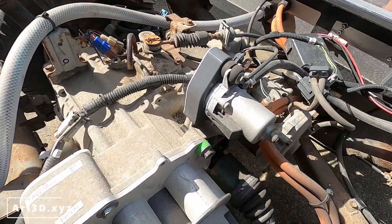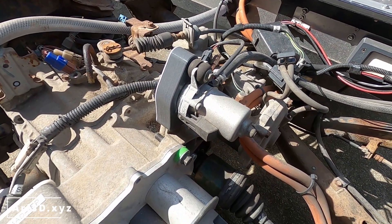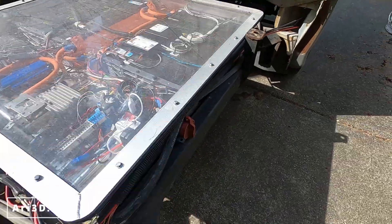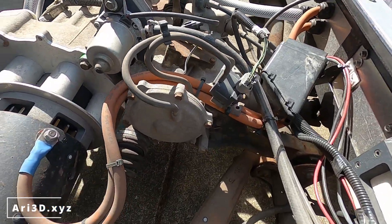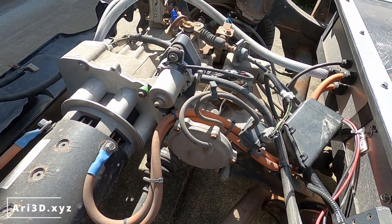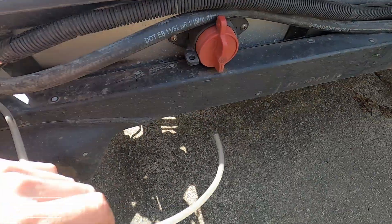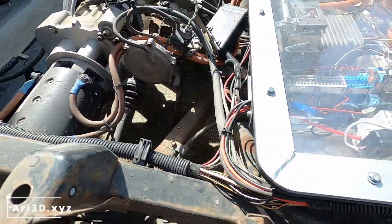Moving up forward, we've got the electronic vacuum pump. Since there's no more vacuum, I've replaced it with a 12-volt one and that runs a hose right along here up to the front and runs the brakes from that. We have the 4-wheel drive actuator so that's still connected, still got the solenoid in there but haven't quite hooked that up to anything yet. So at this point it's a manual process of taking this little hose and running some vacuum on it to engage 4-wheel drive.